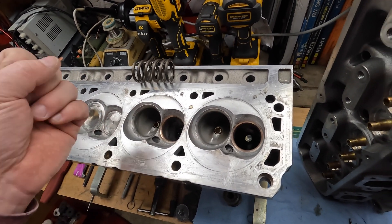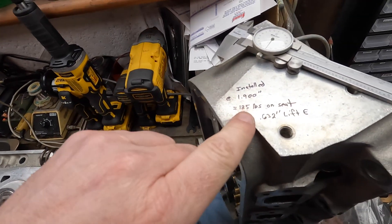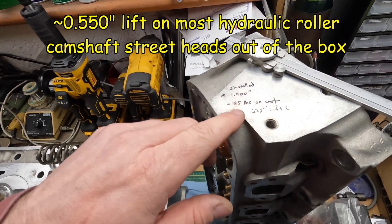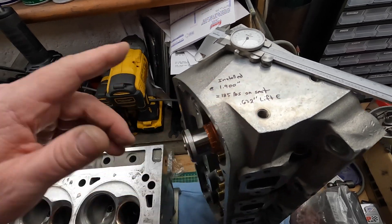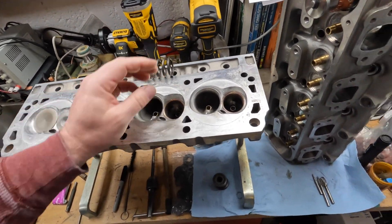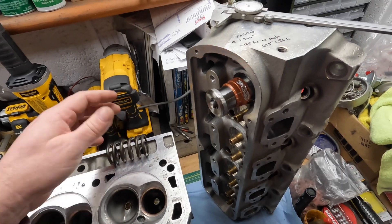You needed at least more pressure because the valves are bigger on the Trick Flow R's — 208s instead of the normal 202s on just about everything else, even like AFR 185s or 165s or other Trick Flow heads. Those usually come with about 140 pounds on the seat at baseline and say their cams are good up to about 0.6 lift. So we're at a lot less pressure with a lot more lift, and old-style springs too. I tried to find a set of springs for these nice titanium retainers and you can't get anything in this size anymore — they've moved on in technology.